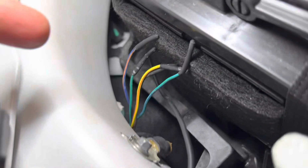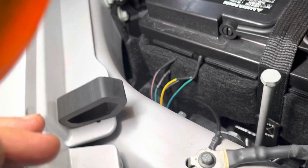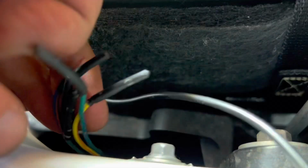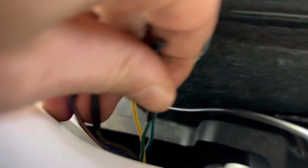So the black cap ones are the switch ones. And then way down there, you can barely see the edge of the white. Those are wires that go throughout the truck, and those are identified inside the screen I was just in as well. So feel free to check those out if you want to use those wiring points. Green brown. There she is. All right, so we're gonna connect my red right here to that guy, and then we'll be able to switch this on and off.